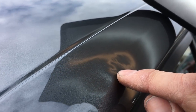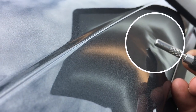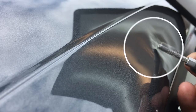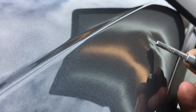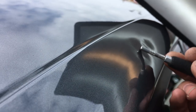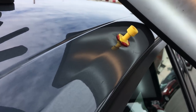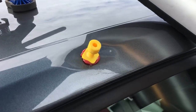There's my finger for reference again. We're still trying to get that very bottom — I've got to get this and then tap down both of these sides all the way around. Knock all these shoulders around. Just keep going in a circle around it, slowly feeding that metal in and out of it to try to get that center to shrink a little bit more. And then we'll be able to come back and take out all the other stuff.